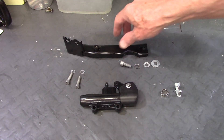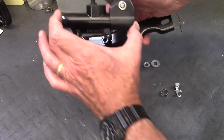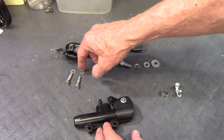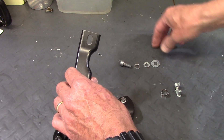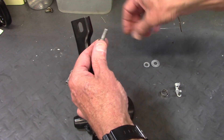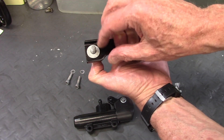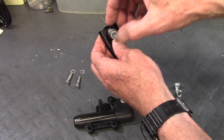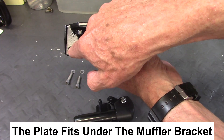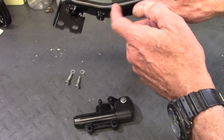This is the rear brake master cylinder and the bracket it mounts on. There are two tapped threaded holes in the bracket so the master cylinder goes right on, using long allen bolts with two wave washers. The bracket front mounts to the swing arm — there's a bracket underneath the swing arm for it, with a wave washer and flat washer on one side, and a large flat washer on the back side, with the bolt screwing into a tapped hole on the swing arm bracket. The rear of the bracket mounts on top of where the mufflers go, so the bolts that hold the muffler bracket also hold the rear of the master cylinder bracket.